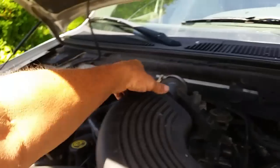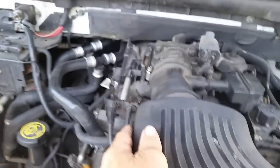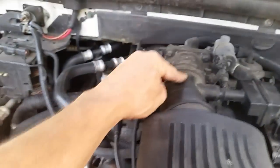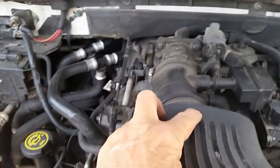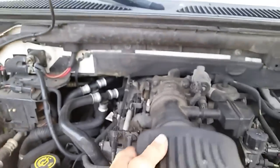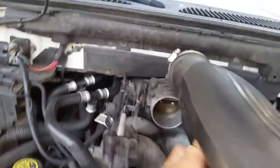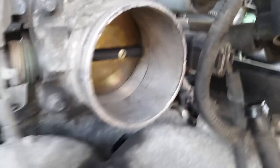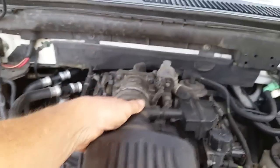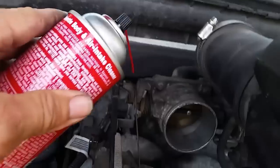When you do this, you can put the pinhole wherever you want. If your throttle body has soft rubber right in front of it, you can actually put the hole right there, close to the butterfly. I just did it further back for the video, but I may put one closer to the butterfly later. Look at it one more time — much cleaner.